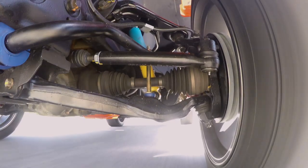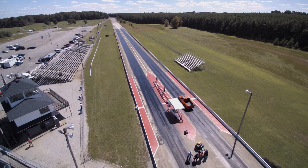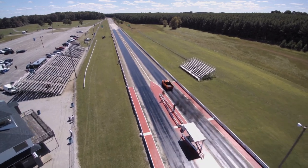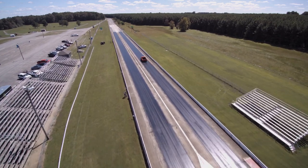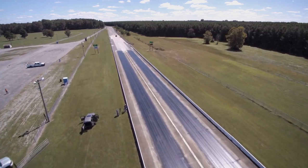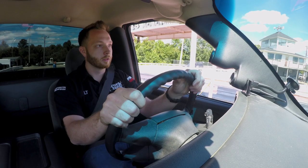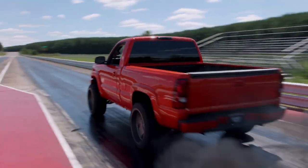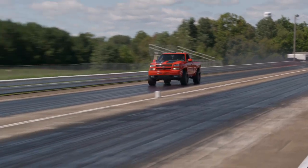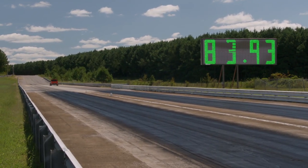The trick is putting all that power to the ground, but the cool thing about this diesel truck is a huge cooling system. We've been hot-lapping it for a little while and the temperature is 172 degrees, so we don't have any worries about it. I'm going to try a couple more passes on tune number three, see if I can get it to stick a little bit better by varying my launch technique. Next, we're going to crank her up to tune number four and see if we can get it to stick on the launch. Street radials aren't meant for drag strip grip and the massive diesel torque just spins the tires, but it does lead to a little faster 9.14 at 83 miles per hour. The trouble I'm having is traction — this thing just wants to spin and spin and spin with all that torque.